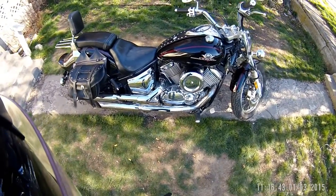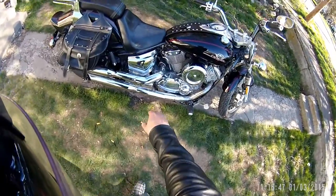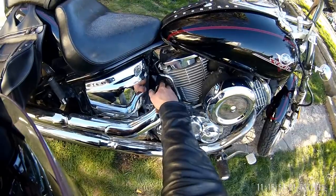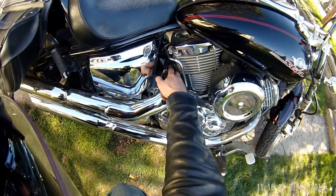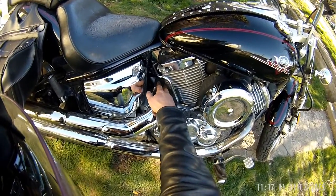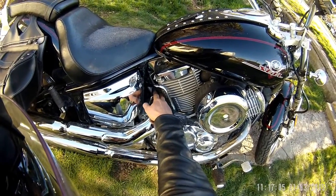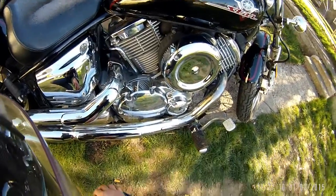There are a few things that need to be done cosmetically, like down in here, this little L bend that goes into the cylinder. Besides the fact that I'd need 2 crush gaskets, one here, one there, to do it. Pull this off, sand it. A buddy of mine's got some high heat paint that'll clean that up really nice.